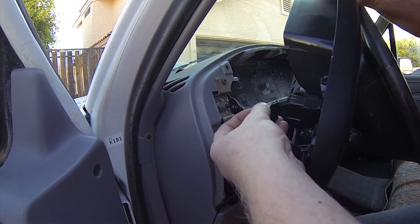Low fuel pressure could be a result of a variety of different issues. One that most people immediately jump to is the fuel pumps. This particular truck has two fuel pumps because it has two tanks, which adds complexity. So the first thing we're going to do is bypass all of the electronics and the engine controls that regulate when the fuel pump turns on and off, and go straight to the fuel pumps to activate them and see if they're actually working — rather than immediately assuming we need to replace a fuel pump.